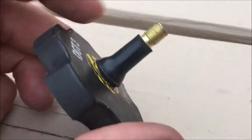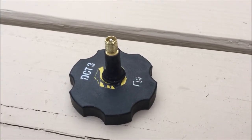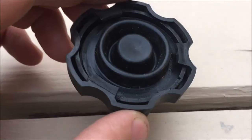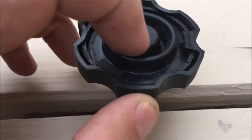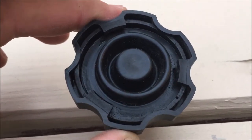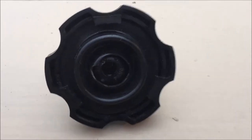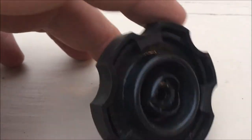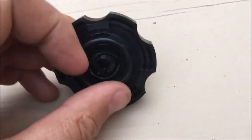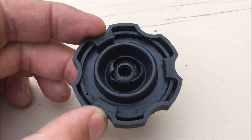The valve stem is now seated and that's it for assembly. I reinstalled the gasket — I'm surprised at how nicely it sits. I'll cut a little hole here so the back side of the valve will let air into the master cylinder. With the center cut out of the gasket, you can see the air will blow through, while the gasket around the outside seals up to the master cylinder cap.